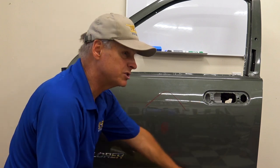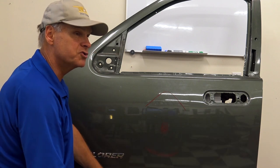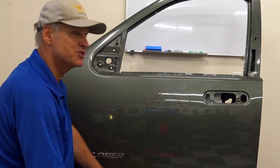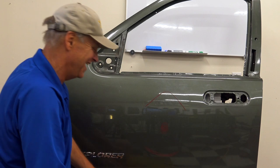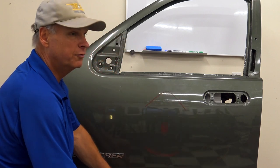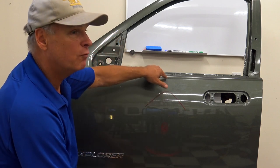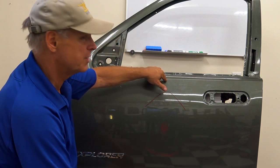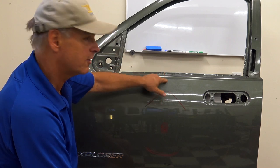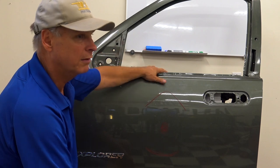They love hiding outside dents. They do that all the time. So in fact, you had that one hide on you on the door just a couple hours ago. Remember, it was right there in plain sight. You just didn't look for it. No, the one at the top. That's right. So about 6 inches at least. I've seen a few a foot away. You know, that does happen. So a foot away. And sometimes they can even be above where your crown was. That does happen. Sometimes you get stacked crowns on them. You'll have one here, a smaller one there, or sometimes even a bigger one.